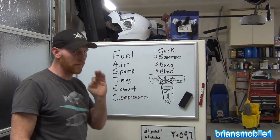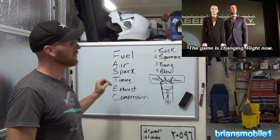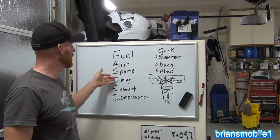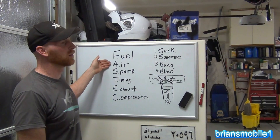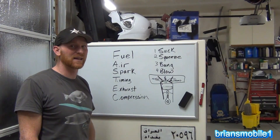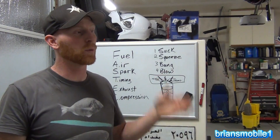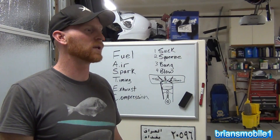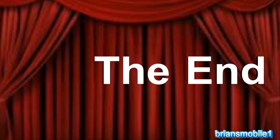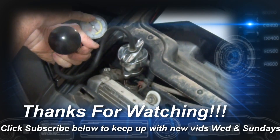How fast was this diagnosis? It was the very last thing on the list: compression. However, if you do the quick FAST Tech method — check your air-fuel mixture with starting fluid, then check for spark, and when you pull the spark plug do a compression test — timing is typically okay, exhaust is typically okay, and you're generally not going to have an air blockage. So: pull a spark plug, check for spark, do your starting fluid test, and that's usually going to get you there pretty quick. I hope you enjoyed this video — click thumbs up, subscribe, and stay tuned for more videos including pulling this cylinder head to see what's burned up.